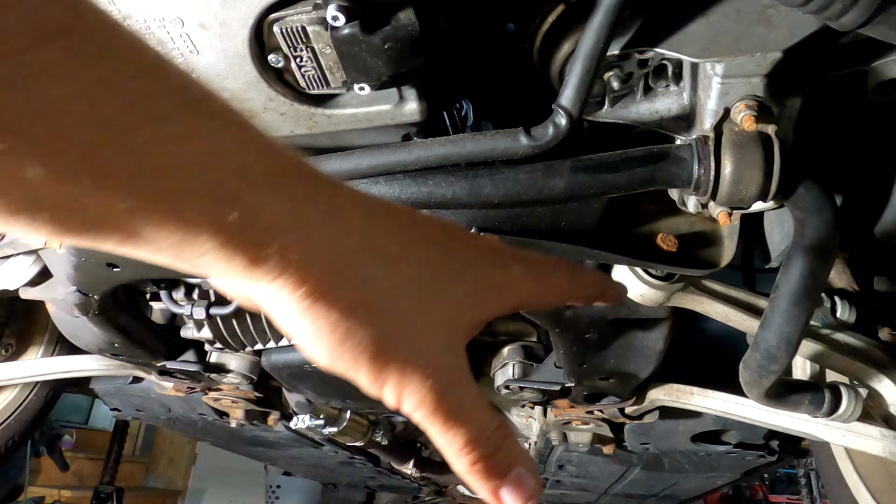Get you an update here on the bottom. I went ahead and removed the AC compressor, and yes, it is hanging by the hoses, which I'm not wild about, but I like that a lot more than trying to discharge the AC system and start over with that debacle. So got that removed, got the sway bar loose. I think that'll be fine. I'm going to take the serpentine belt off for the AC, obviously. A couple of electrical connections.